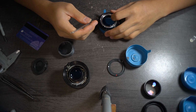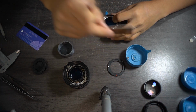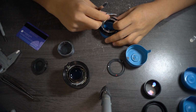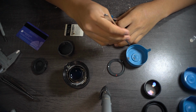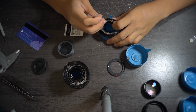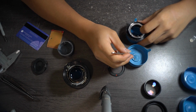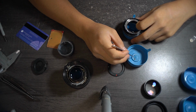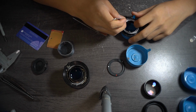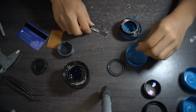I'm going to have to hold this thing down while I use the tweezers, and I'm also going to use one of these plastic cards to spudge the bearings. They do not fall into place because they have some grease on them, so they sometimes stack two on one. You have to push them down with a plastic tool. To start, you can actually use a magnetic one. It's a bit better, but in the ending bits you do not want to use a magnetic one. Let me just do it one by one. It might seem boring for you guys.